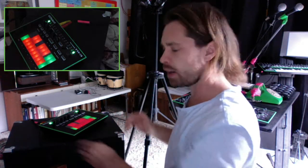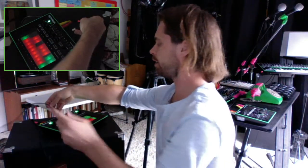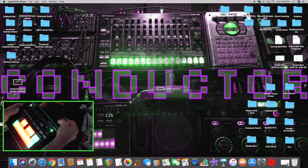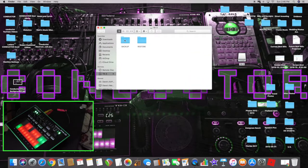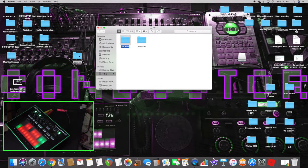So we're ready to plug in the USB. I've got a USB Type-B end and the Type-A is running directly into my computer. I'm just going to plug that in. Once you plug it in, you'll see on your desktop — there it is — this TB3 file pops up. You open it up and there's two files: a backup file and a restore file. I'll drag this backup file onto my desktop and I can save it with a different name or the date that I backed it up.